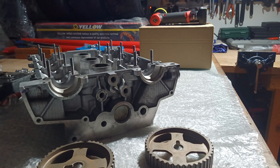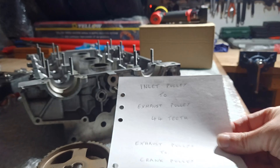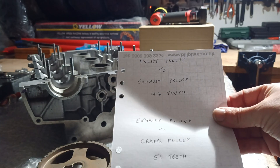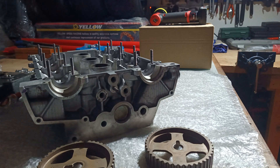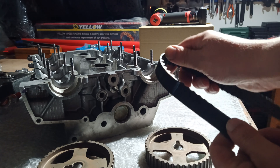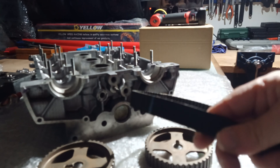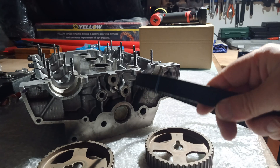But that's the only belt that does this, so if you buy another brand belt I would suggest making the markings yourself. The first thing to do is make a mark on the belt in any position you wish. I've pre-marked this belt - you can see there the white marker, that's just a little bit of white paint.